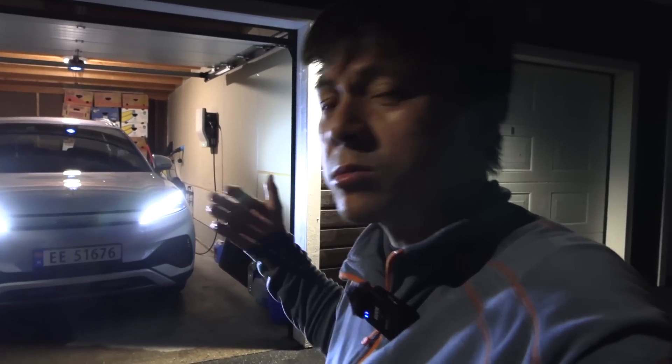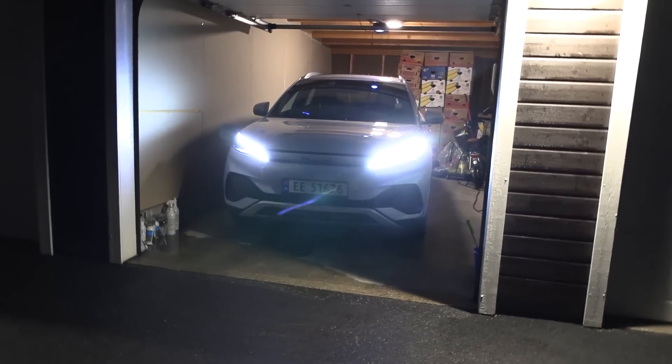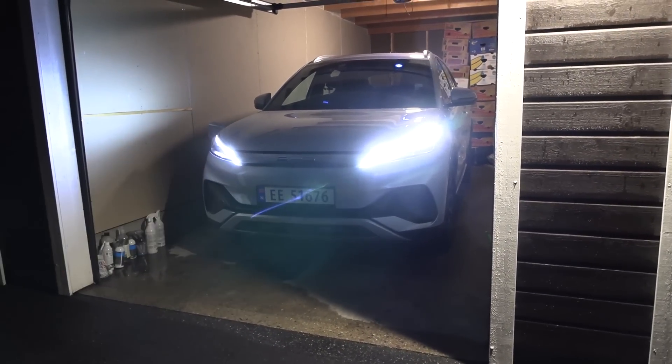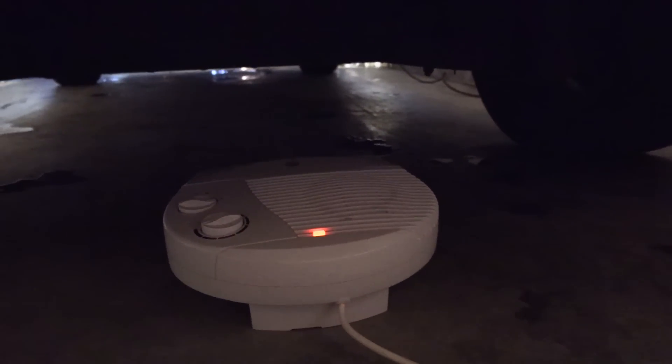I want to do some experiments to figure out why it's overheating and whether it will do that in Thailand. I have some theories to test. First, I've done some charging tests — the car was at 100%, so I needed to heat up the battery but also discharge as much as possible. I connected the vehicle to a load adapter here, with a long extension cord, running a 2 kilowatt heater to heat the battery, and also running a dehumidifier.